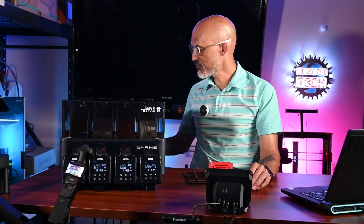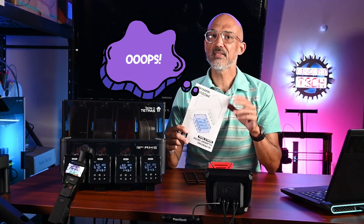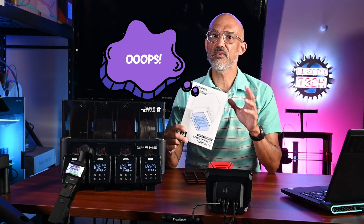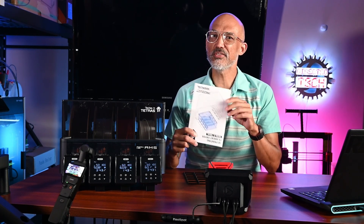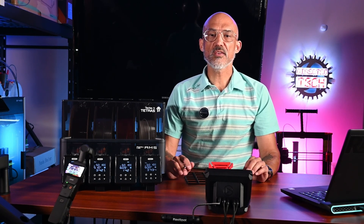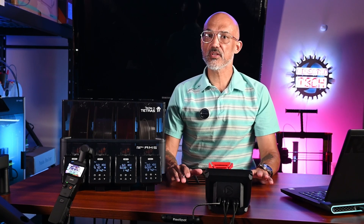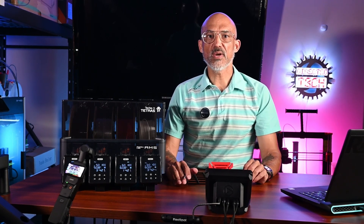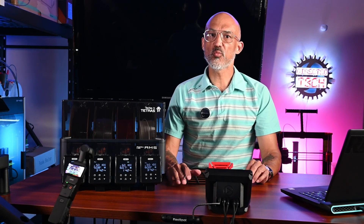Here's a really fun thing to note — I was able to provide input on a rewrite of the manual since English isn't the native tongue of the folks at iBos. Kind of cool to get to make the product manual a little easier to read. Finally, when a humidity value is set, the humidity mode turns on after the drying process is finished. The device activates drying automatically when ambient humidity exceeds the set value and stops one hour after the target humidity is reached.